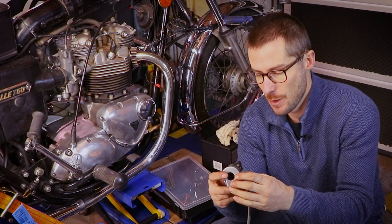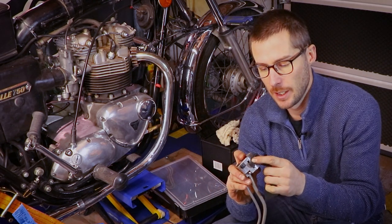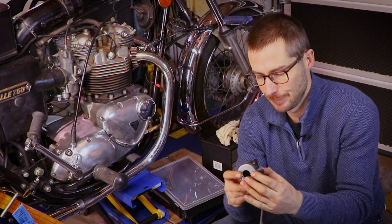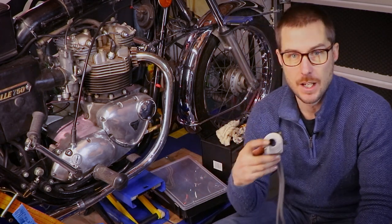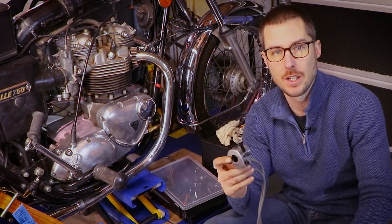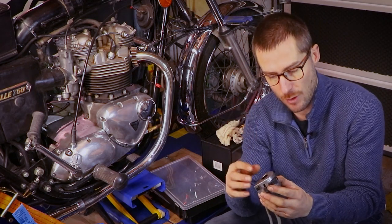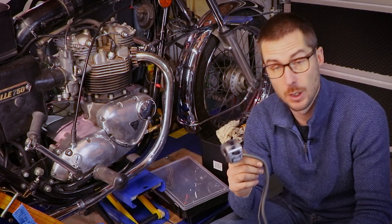More seriously though, there is a detent ball and a spring in the high and low switch, and there's another spring in the signal lever. So the good thing about this is that I did clean up the contacts and everything, so it's a good thing done, but it's a real pain in the ass and a genuine time consumer. So if you have lots going on in your mind, or you don't have much time ahead of you, leave it alone, because you'll go nuts.